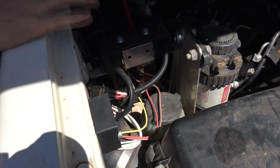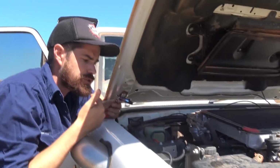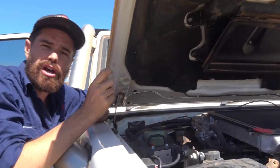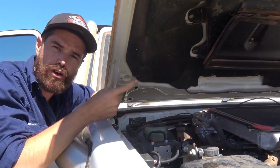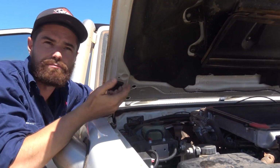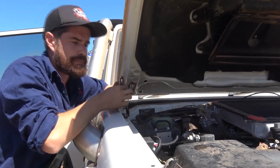Few simple wires. All I had to do was connect it into my power outlet for my ignition and my battery. Run the hoses straight into the valve block, and they go straight back to a 3-way junction. One branches off to my fittings that I use for my normal up and down pump, whatever I'm pumping up, and the other one goes straight to the airbags.